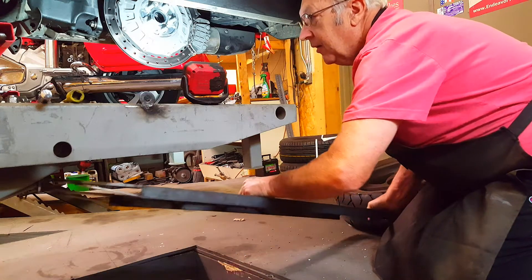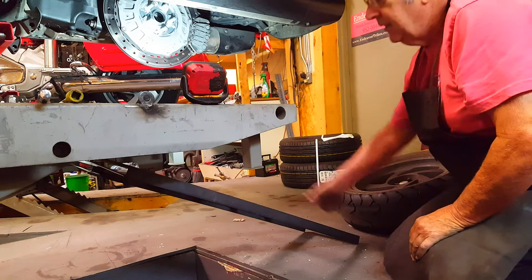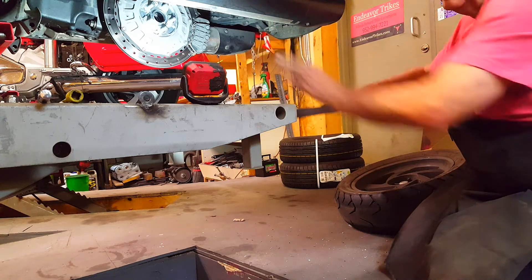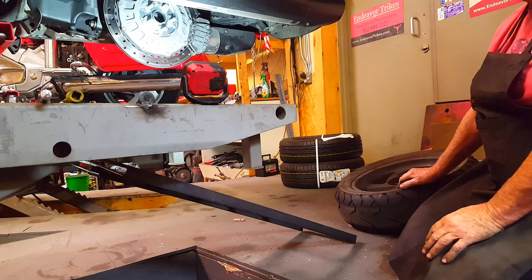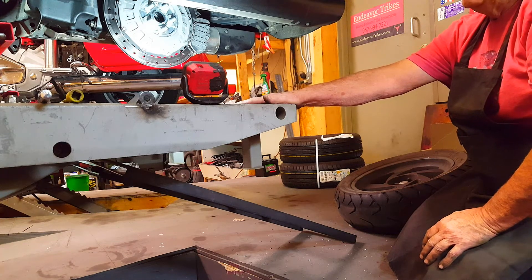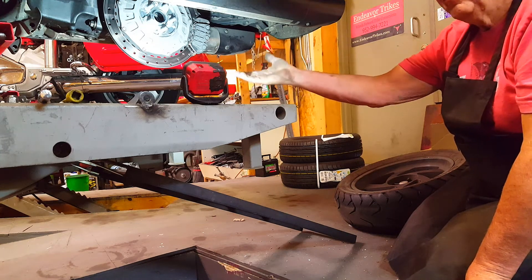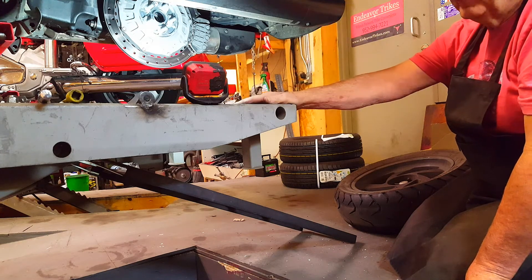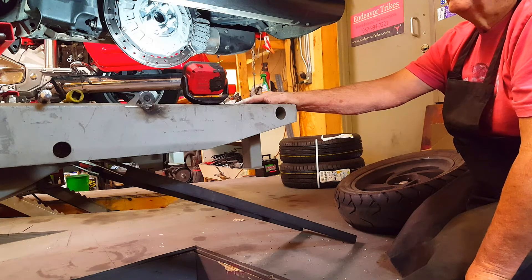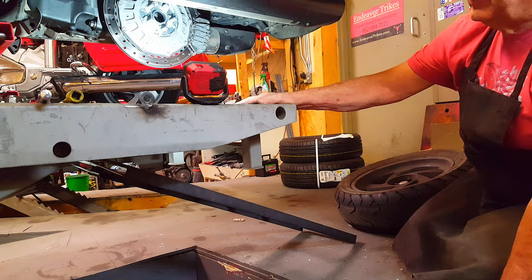I usually hook it up here so it doesn't drop in the front. When I get the new tire in here I roll the tire up, lift this up, put a prop underneath, slide the tire right on, and it's a slam dunk. These lifts really work out well. A lot of guys will take Gold Wings and tip them on their side — lay them over on the right side and pull the wheel out. That's a perfectly good way to do it. There's no problems with that. You're not going to wreck the bike or do any harm to it.